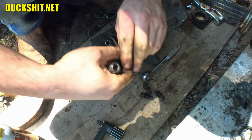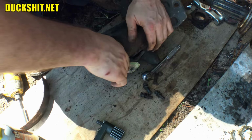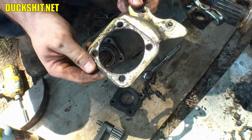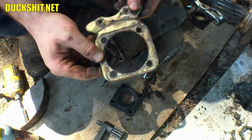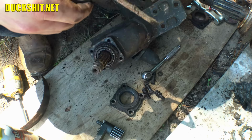Okay. That's our brake bracket. You can see the angle that's in it. That's supposed to be there. And this was mounted, as you saw, going straight up and down. So the caliper sits on top of the axle, and I don't think that's the right way to install this. I'm gonna show you the way I think is correct, because we're gonna do it that way. And unless we have a fitment issue, that's how it's gonna stay. And this arm, meanwhile, can go away.